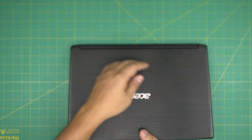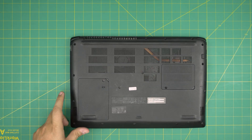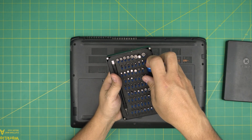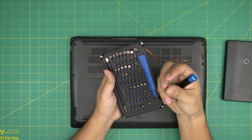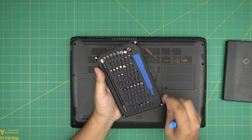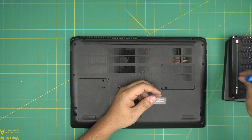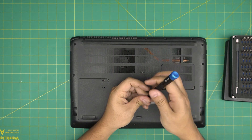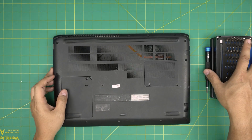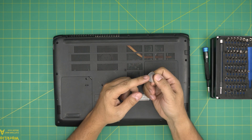First thing, you want to power off the laptop. For tools: tool number one is a screwdriver set — I recommend the iFixit screwdriver set, as they have one of the best bits made out of S2 class steel and they will last you many years. We're going to be using a Philips number one and a Philips double zero. If you get the pro set it includes opening tools, tweezers, and more. If not, grab a guitar pick — metallic guitar picks are great for opening cases.